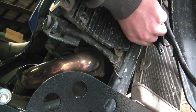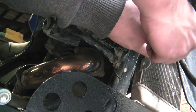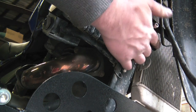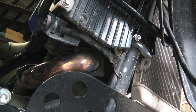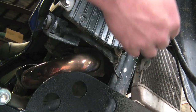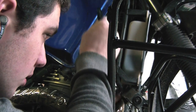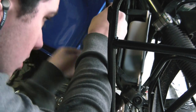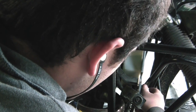The next step is to install the front bracket. There are two bolts to go through and bolt from behind onto the cross bars — you've got two little brackets that sit either side that clamp around the tube. This is probably one of the hardest parts to get right, it is a little bit fiddly. The front bracket is the smaller one with little engravings that say 'up' and have an arrow pointing forward — smaller one on the front and a thicker one at the back. The right-hand cross brace goes in first, being the non-threaded one.